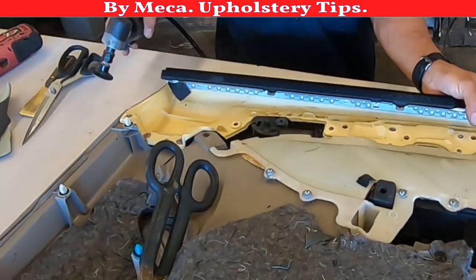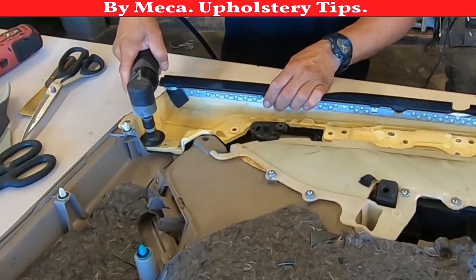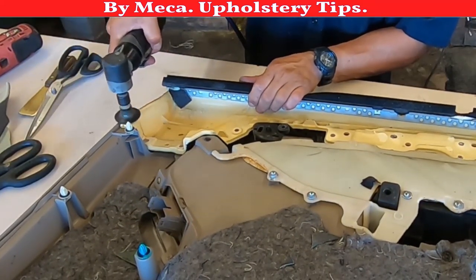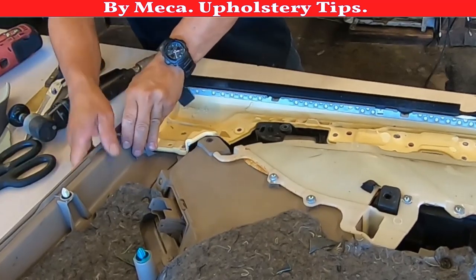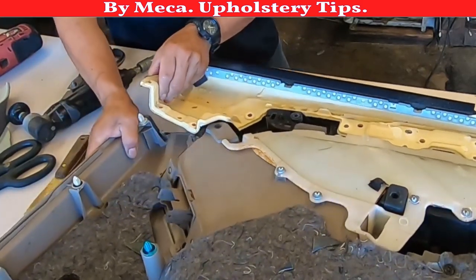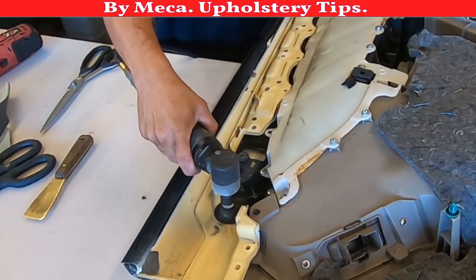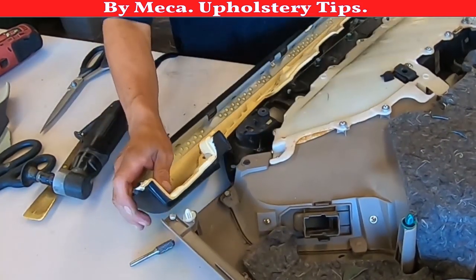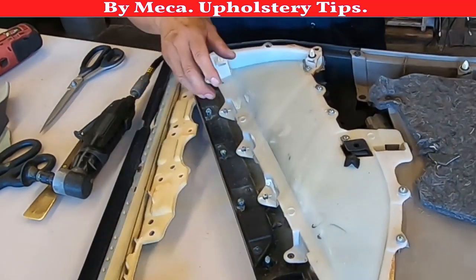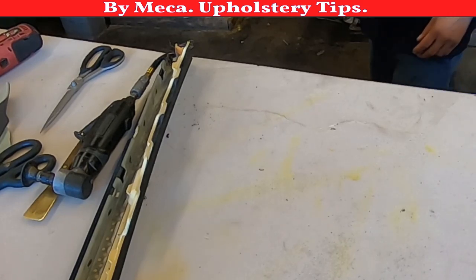Same thing with the other ones — you're going to sand all those clips. You need to cut a little space right there so you can get access. Without cutting that space I wouldn't be able to remove those parts. The part is still glued on there — I just use a spatula or a flat screwdriver. That part is out, and I have one more clip to go. Look how easy this part comes up. Those clips I can reuse — you'll see how I use them back.